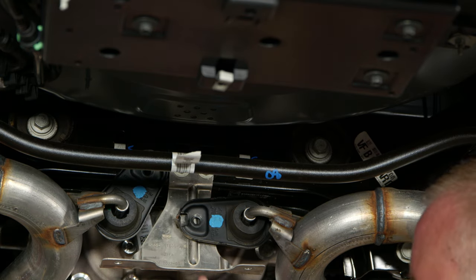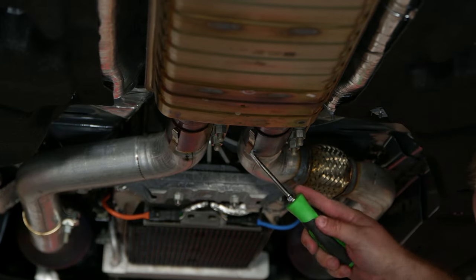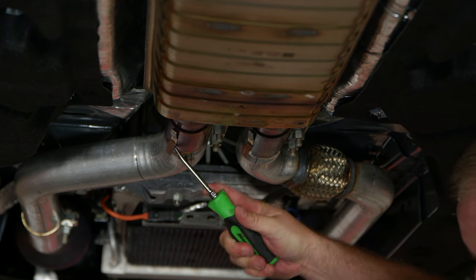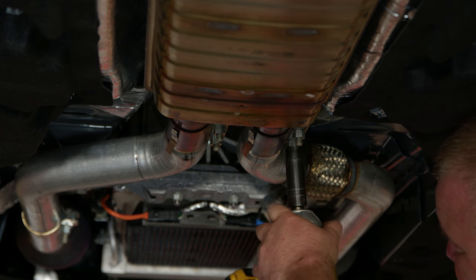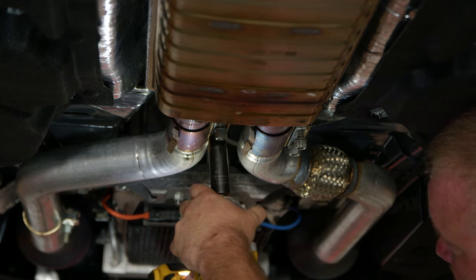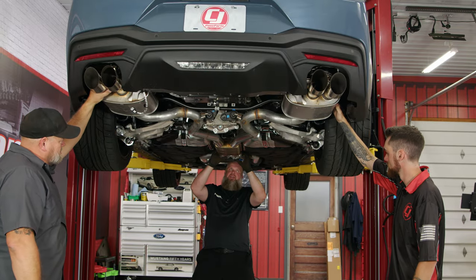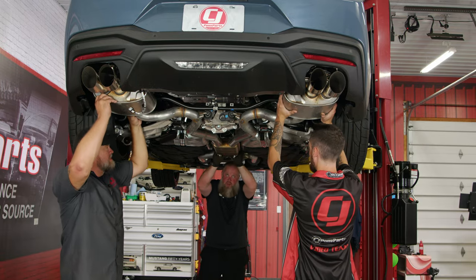At this point, bend the bracket a little forward just to make the exhaust easier to remove. Moving to the front of the car, first pop the tabs out on the clamps, then loosen the four nuts. With the clamps loosened, you can remove the exhaust — it's easier if you have a second pair of hands. Slide the clamps forward and then slide the whole exhaust towards the rear of the vehicle.